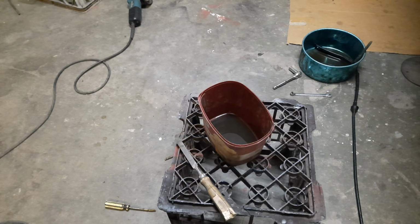Does the same job. One thing with the oil too, if you've got oil inside your brake drum and you're not sure if it's diff oil leaking out of the axle or brake fluid, well, you should know anyway if it's brake fluid, because your fluid level will be way down if it gets to that point. But there's only a little bit in there. There's one way to tell, and that's what solvent you use. Oil will be dissolved with petrol and stuff like that. So if you put petrol and it doesn't dissolve it, then it's brake fluid. If you put methylated spirits, alcohol, in it, and it doesn't dissolve it, then it's oil. Methylated spirits or alcohol dissolves brake fluid, but it won't dissolve oil. And the same with petrol. Petrol dissolves oil, but it won't dissolve brake fluid.